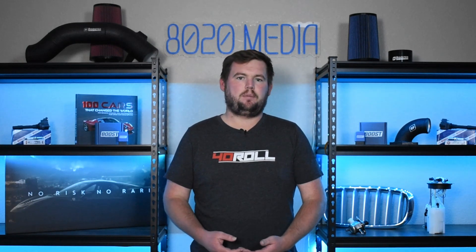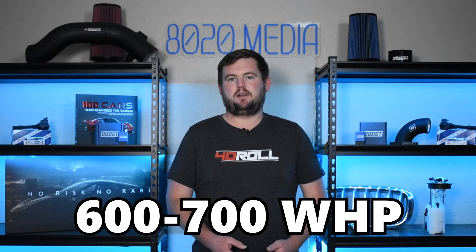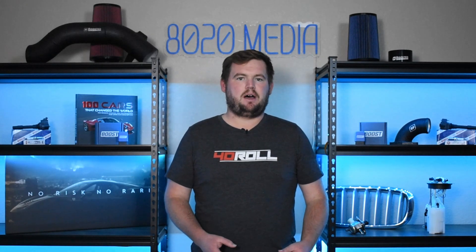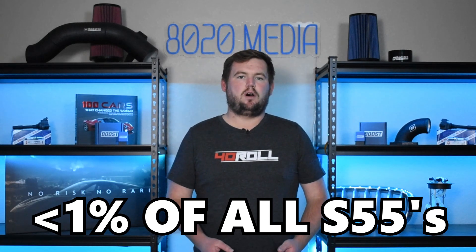Ultimately, it's something to be aware of. However, it's not something I would worry about or really stress too much about unless you are planning on pushing 600 to 700 plus wheel horsepower, especially on upgraded turbos. When you get to that point anyway, you're at a point where it's probably worth starting to consider building the engine or at least doing a couple of these reliability upgrades. So in the grand scheme, it is something to potentially address if you are looking to build a very powerful S55. But in stock form, or even just with light modifications on these stock turbochargers, it's a very low percentage — likely less than 1% of vehicles — that are affected by spun crank hubs.